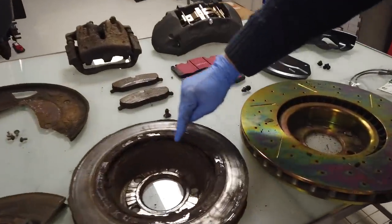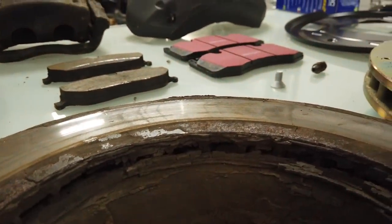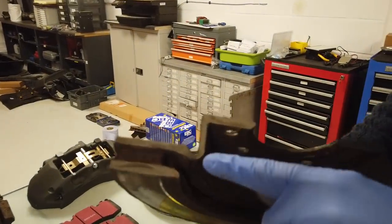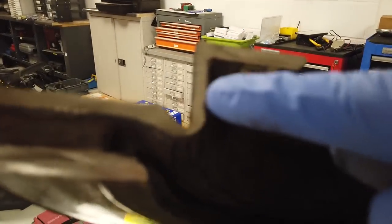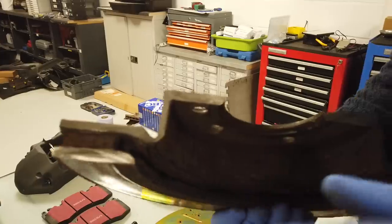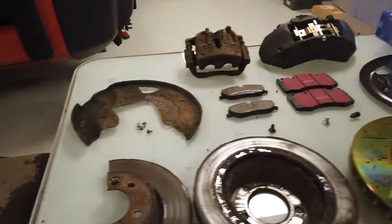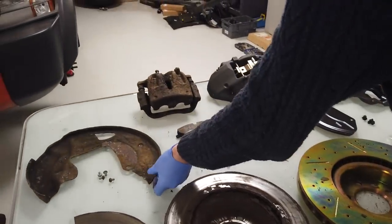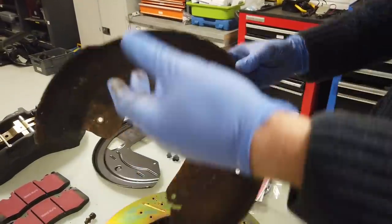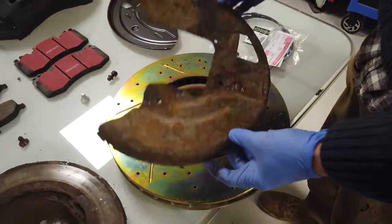I was talking with Gary and I said look how thin it is here - you wonder how rusty it would have to get for the disc to snap. It's actually still got a fair bit of thickness, but it is interesting how thin it is at this point - this is clearly the thinnest point as I've cut through. Actually I didn't need to panic too much, but we digress. What else are you going to need to change? Your back plate is not big enough - this is a dust and stone shield. The disc is bigger than the back plate, so that's never going to be any good.